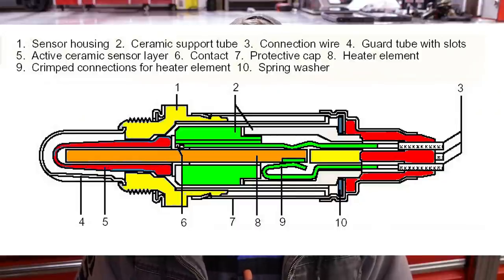To fix these issues, they came out with a three-wire oxygen sensor. What they did here was finally add a heating element inside the oxygen sensor. This heating element made the sensor get very hot and up to temperature much, much quicker, allowing it to start sending a voltage to the PCM and get from open-loop to closed-loop status much, much faster.